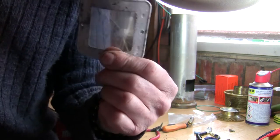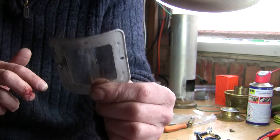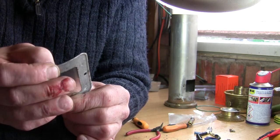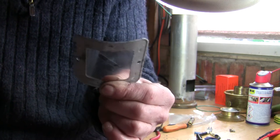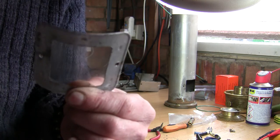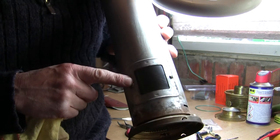There's our new piece fitted — I've put my messy fingers all over it but we'll put it back into the heater tube now and tighten it up, and then hopefully be able to give it a little clean. If not, we'll find that when we light the heater it will burn off — this is subject to intense heat. Mica is amazing stuff; I've just cut that with some scissors but it is made from stone, would you believe. So we push it in — not a difficult job at all. That's another job done; the new mica window is back in and I can at least now see through there better.